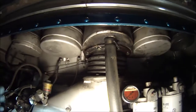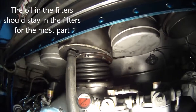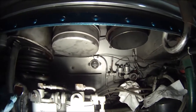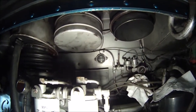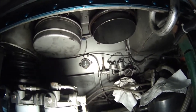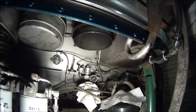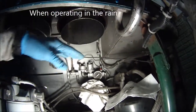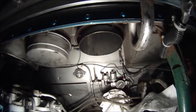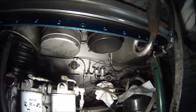A little bit will pull up through there and come down, but I was getting quite a bit — an unusual amount — and that's why it's so dirty and I have to finish cleaning this up. That's usually an indicator that you have too much oil, and the reason you'd have too much oil is because the bottom of the oil bath pan fills up with water. On the 4106s, the air intake on the right side seems to suck in a lot more water, so this first one on the right side fills up with water faster than the others. I just pulled the other three off and there's no water, but when I pulled this one off it was full of water up to the top.